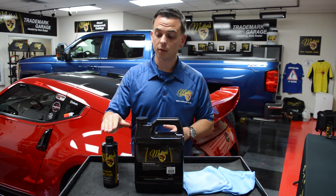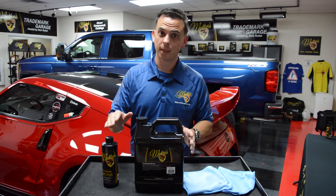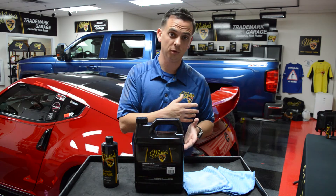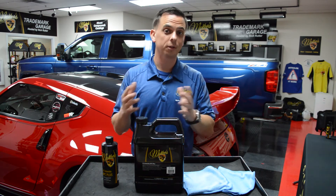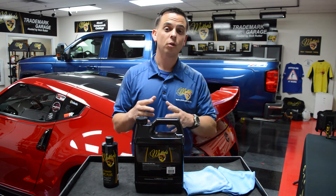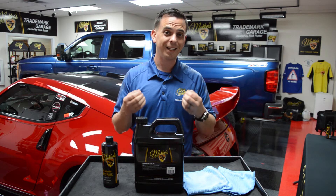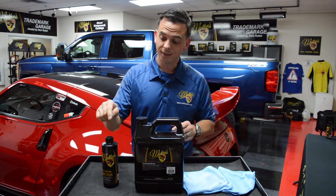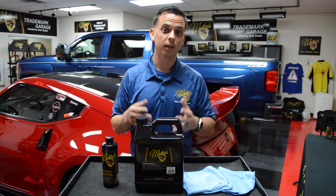What makes this formula unique is that it's non-caustic, so it's surface-safe for virtually every material depending on how you dilute it — one to 10 for light duty, one to four for heavy duty. With this formula, if you use it on leather especially, what really makes it stand out is the fact that you don't have to rinse afterwards. The same goes for chrome and other exterior surfaces. Most all-purpose cleaners, because they're highly alkaline, require you to rinse the material with water after cleaning — that's not the case with this formula at the proper dilution.